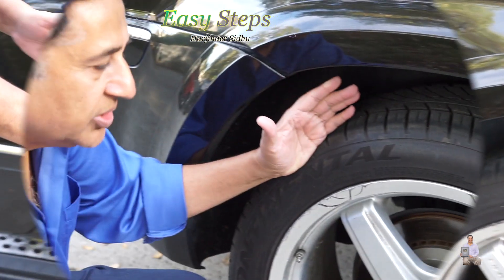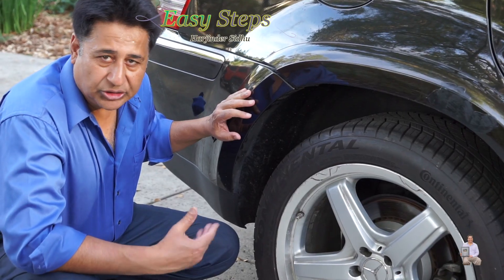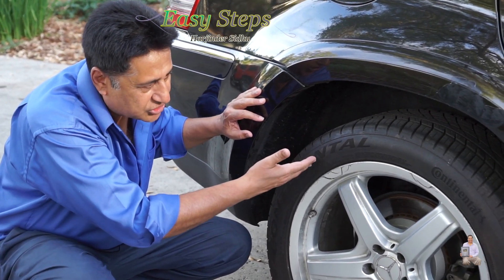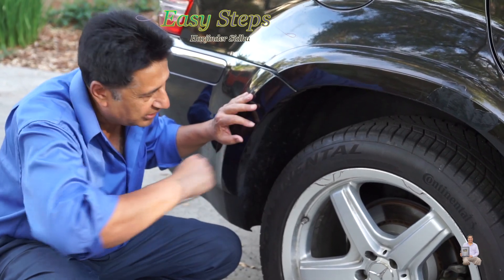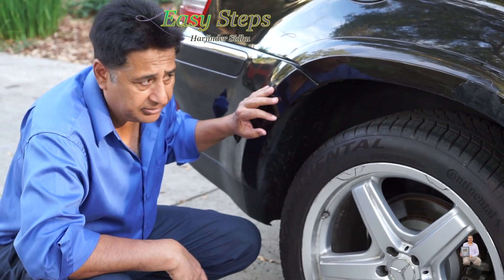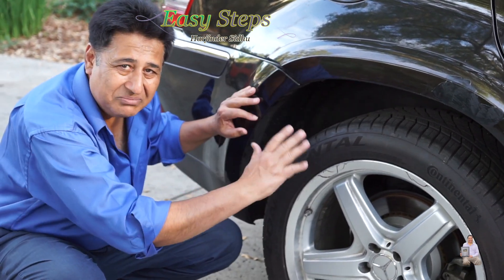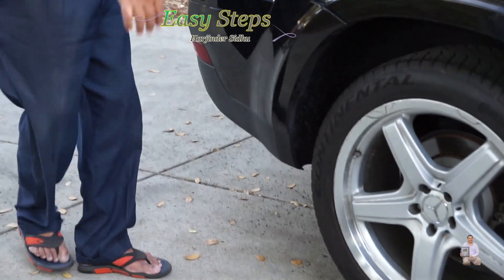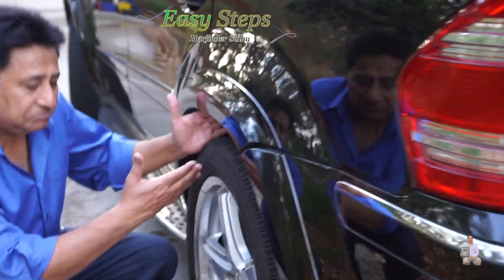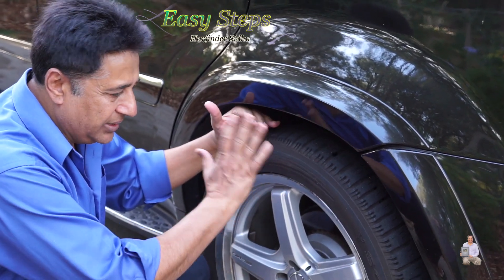And if we go to the back, at this moment if you look, we have a nice gap, so it's working. This was happening for the last couple of weeks. Now if you see, the air suspension is going up again — the bag is filling up. And even while driving, all of a sudden it goes flat. So there was a problem. Now it's going down, so it's going up and down. Let's take a look on the other side — it does the same thing, going up and down.